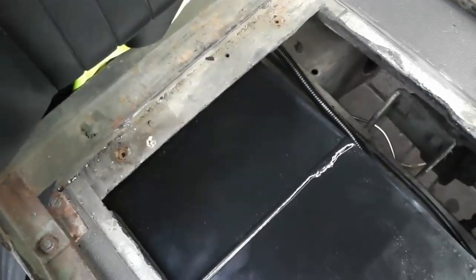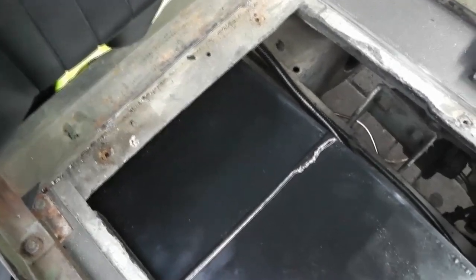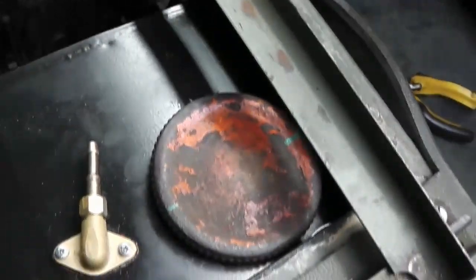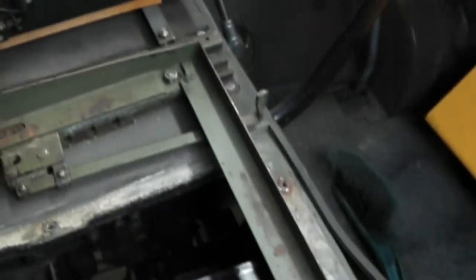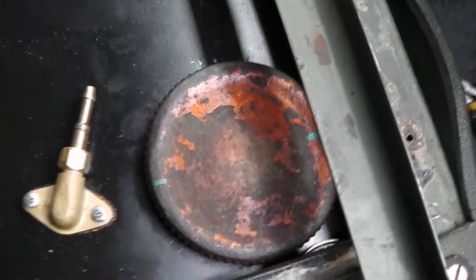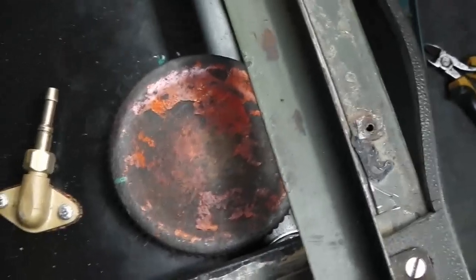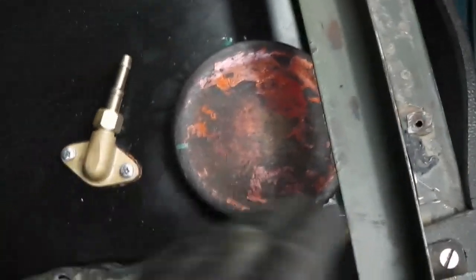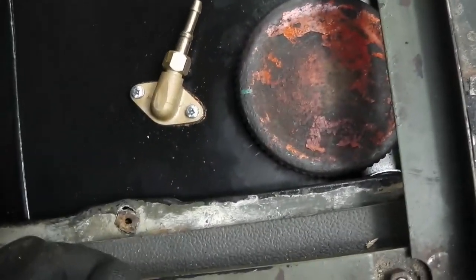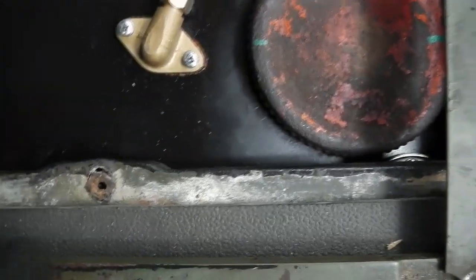Basically the rear bolt hole needs to move further forwards so I think I'm just going to have to file it out to fit, but we can make that work. You can see it's close here where the filler neck is - I've got the seat right back. This one's adjustable so you can pull it right forward, but you can get the filler cap off. You can actually with the seat forward pull the filler neck out, so that all works fine. I think there was a different panel but I don't really want to take all the seat base off for that - not necessary.